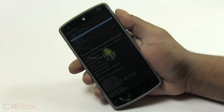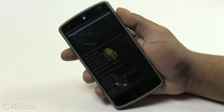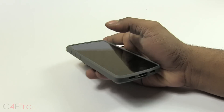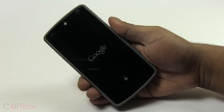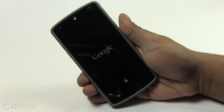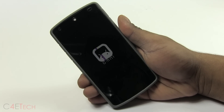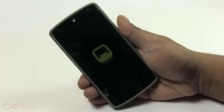In Advanced, wipe the Dalvik cache. Now go back and hit 'Reboot system now'. Your Nexus 5 will now reboot into OmniROM. Keep in mind the first boot into a custom ROM will always be longer than your regular boot times, so don't panic if your phone takes about two or three minutes to boot up — give it time and your Nexus 5 will boot up.